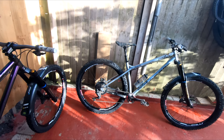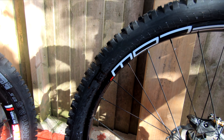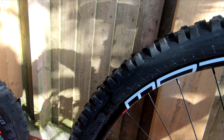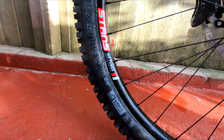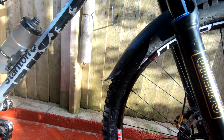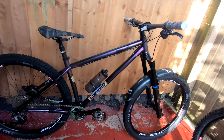Also, if you've been keeping an eye on the media and videos, you'll see that we've fitted all the WTB tires. Here's my big boy, the 29er Switch Niner. On the rear you can see the sealant I'm using is Ty Tire Yogurt — there's a little bit of red coming through the edges, which is quite normal with sealant overnight. I've got a Vigilante 2.6 29er on the back, and then on the front the same Vigilante 2.6. Both of these are the Light High Grip, so they're a lot lighter tire but still super grippy with a lot of sidewall protection — a lot more than any sort of Snakeskin.